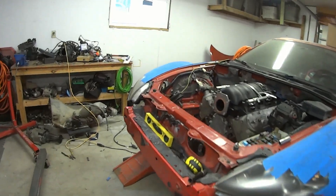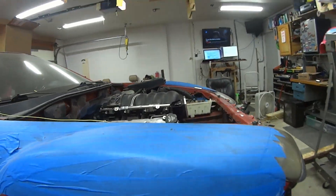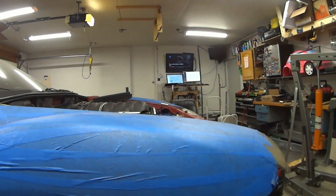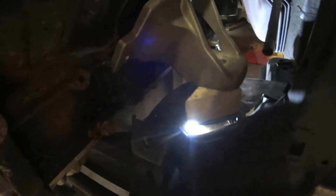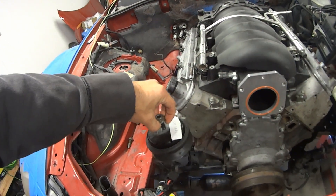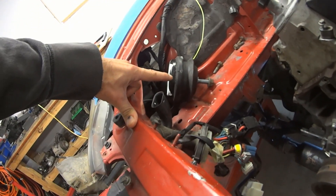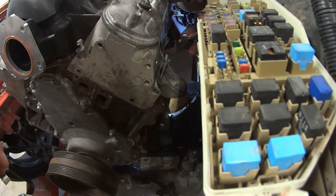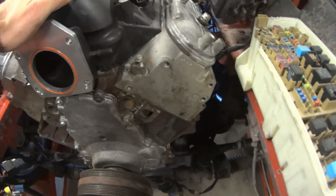I am back at it working on the RX-8 and trying to mount the engine. I have it sitting in place roughly where I want it, but I'm noticing the intake sits a little bit high. The plan was to use these stock C5 brackets and put the stock C5 engine mount between my brackets and the brackets on the side of the engine. But the 2x4 is only about an inch and a half thick, and these mounts are 3 inches thick. Turns out I was mistaken — that's not how the LS1 RX-8 kit does it. They provide their own mounts about the size of a hockey puck, roughly an inch, which would bring this down about a half inch from where it sits now.